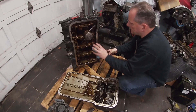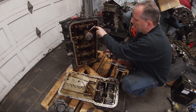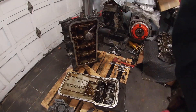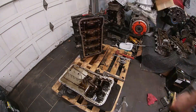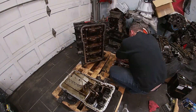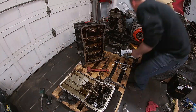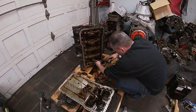The next thing we're going to do is get this oil pump pickup off and get this cradle apart and have a look at the oil passages. In this segment we're going to start removing the connecting rod bolts and all the bolts that hold the block together. It's a split block, so the crankshaft sits between the two block halves.